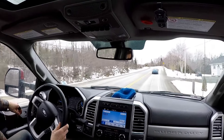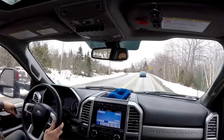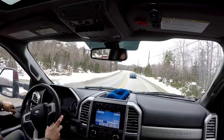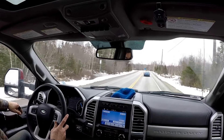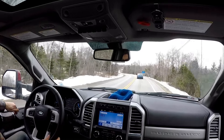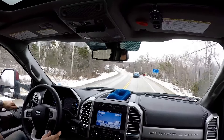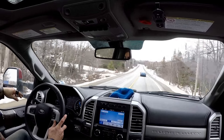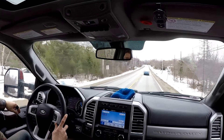Those airbags make a huge difference. Right now with the trailer empty I've put 60 pounds in. Generally with an empty trailer I'd run around 40, but where I'm going to be getting that load of gravel put on the truck, I want to make sure I have a decent amount of pressure already in the airbags before I get that load on the back of the truck.